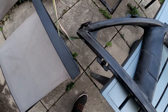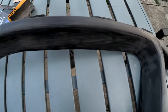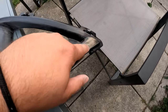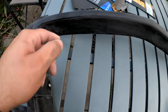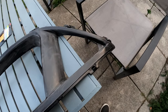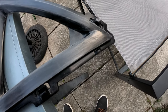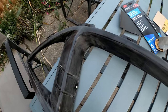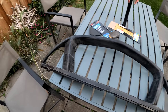I just finished my first pass. I used 400 and then went to 600, which seems to have worked pretty well. I missed a few spots so I'll go back over those now. The idea is you just want to scuff any surface that's going to see paint — back to the bare basics, no clear coat, none of whatever glossy stuff they put on this.